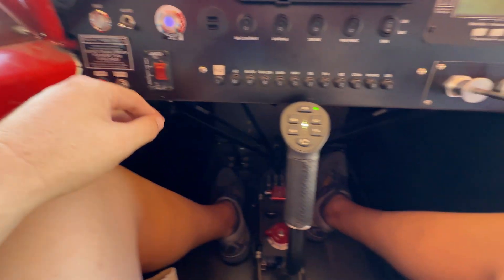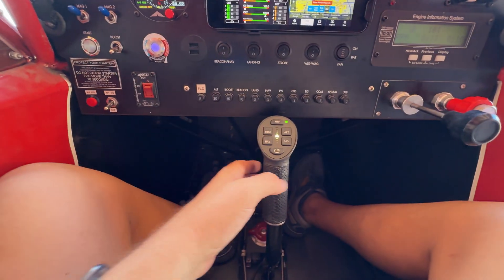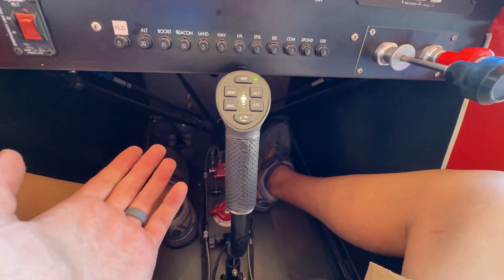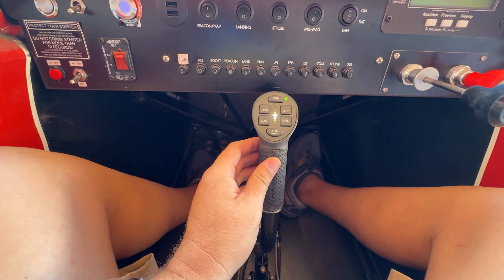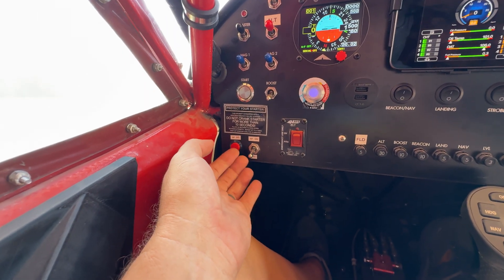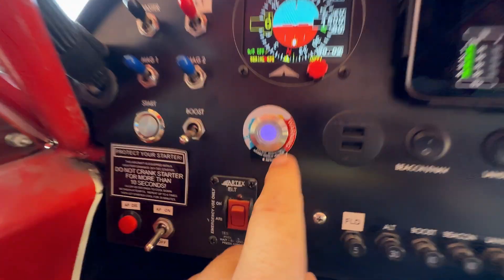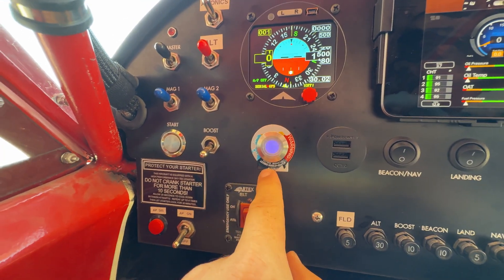Down over here I have a couple more switches. This is for the autopilot, which is also controlled by this guy right here — the trim tabs that you can see behind that little yellow piece up there. There's one on the elevator that lets me control the actual trim of the airplane with a little roll, so even though I have this main one right down here, I'm able to control it electronically. They're small enough that they're easy to override. I have a quick disconnect button up here — an autopilot engage/disconnect — and this is literally a physical disconnect to those servos. During takeoff and landing I can turn them off so there are no problems with accidental runaway trim tabs.